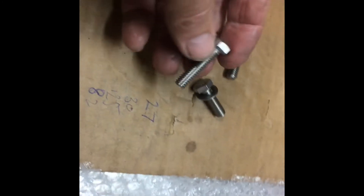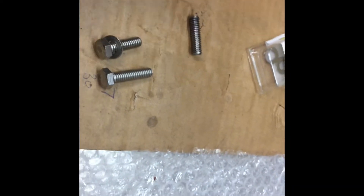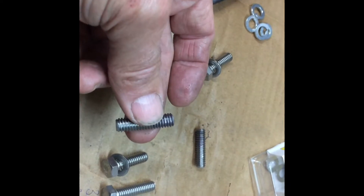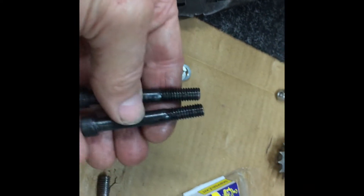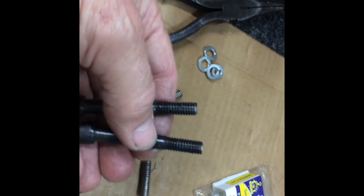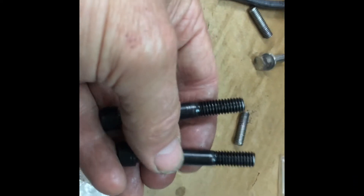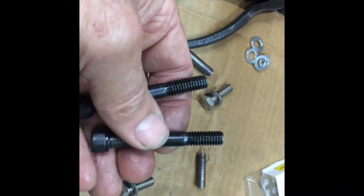We're going to have to do that. I had these bolts here - they're an inch and a quarter, they're an inch. So I chopped this off here and made a little start, but it only gives me about five mil of thread. So what I'm going to have to do is make some longer studs out of these and I'll just have to get some nuts. I'll be able to at least get it mounted today. I'll just turn them down there - 5/16th Whitworth coarse.